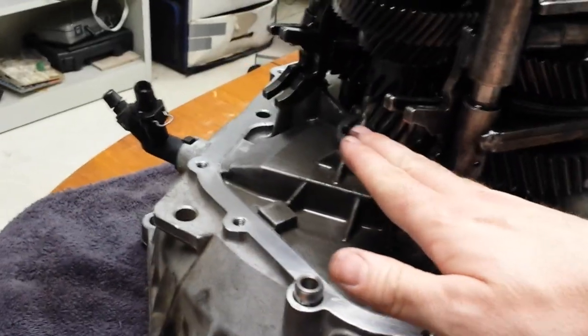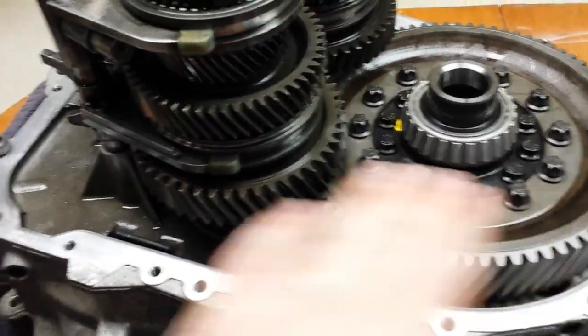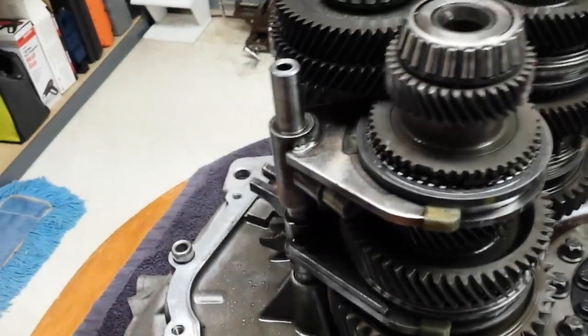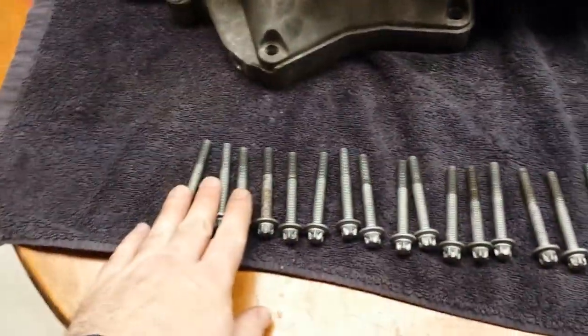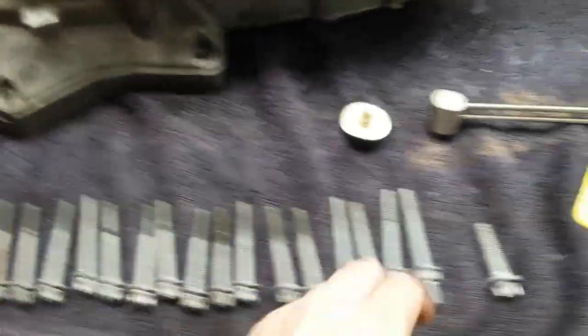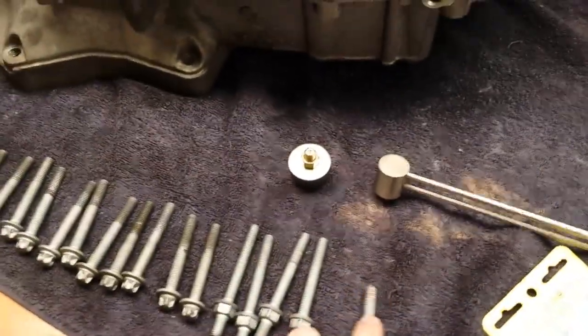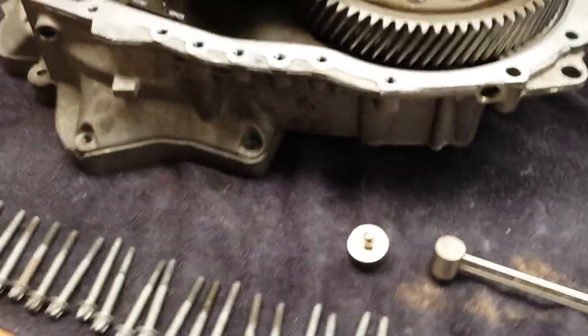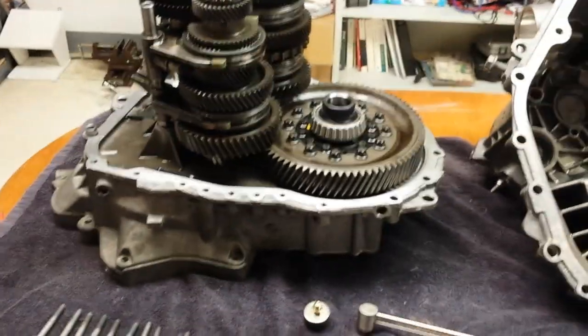The only other trick is to make sure the transmission is in neutral. If you were to put this all back together and it wasn't in neutral, you wouldn't be able to get your shifter mechanism back in, and you'd have to take it apart, clean all your RTV off, and do it again. I cleaned off all these surfaces already and I'll give it one more cleaning with rubbing alcohol to make sure everything's perfectly clean on both surfaces. Then I'll put it back together. These bolts — most of them are M8s, torque spec is 15 foot-pounds. The one that's bigger is an M10, spec is 37 foot-pounds. Put the sensors back, put the shifter mechanism back in, the reverse sensor and the speed sensor back in, and there I'll have it — LSD installed. Hope that helps.